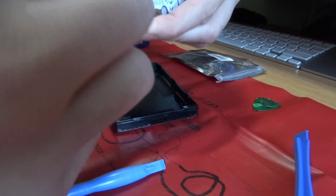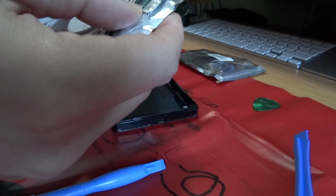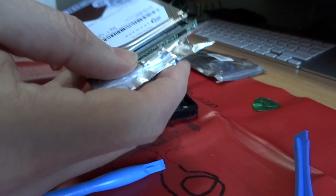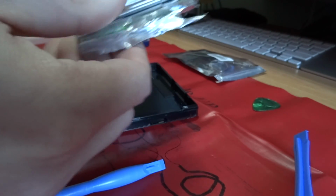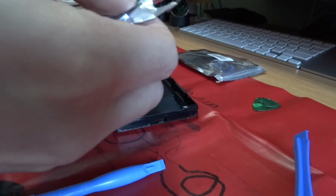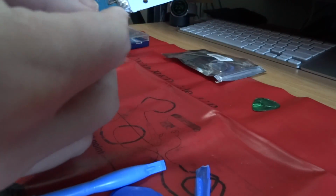The reason why it's good to buy a Seagate versus a Western Digital is because Seagates actually use a traditional serial ATA hard drive and a serial ATA to USB converter. You have to be careful with the Western Digitals or some other external hard drives, because those are what's known as Franken drives, where they do not have a normal SATA bus and they are directly soldered to a USB plug. Yeah, there was more tape.